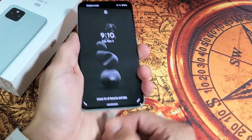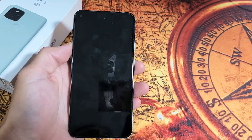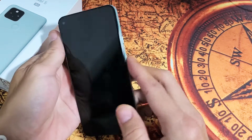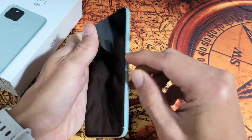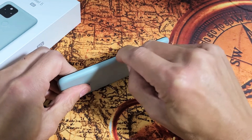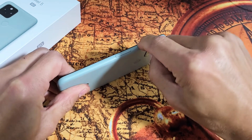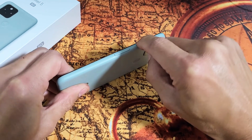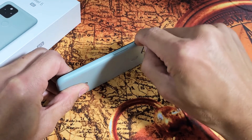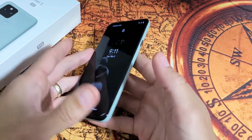You can go ahead and unplug it if you wish — it doesn't matter, you can leave it in or have it unplugged. From here, what I want you to do is spam your volume rockers up and down. Just go volume up, volume down, spam it like crazy. Same thing with the power button too — in and out. Because sometimes if you get lint, dust, sweat, lotion, soda, or coffee in there and one of these buttons gets stuck, it can cause all kinds of issues, especially the black screen.